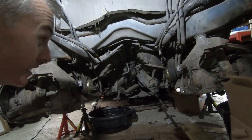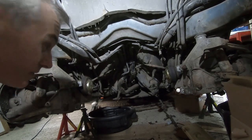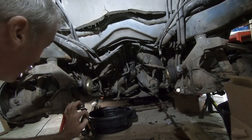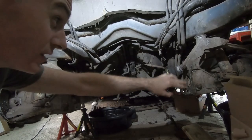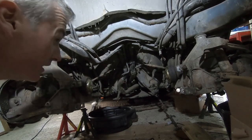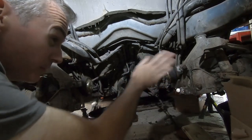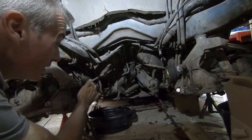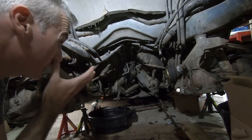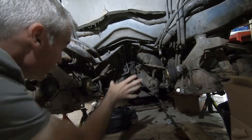The space here is essentially the front end of the transmission and rear end of the engine. This point here is the two uprights for the suspension, with different suspension parts attached to the top and bottom. There's a crossmember that we'll be reinstalling, and basically the engine and gearbox used to meet at this point. We've got the two half shafts sending power to the rear wheels, so we're going to want the main part of our Nissan LEAF reduction gear mounted in the same place.